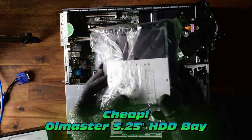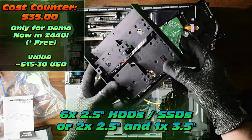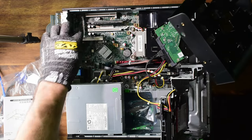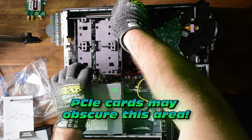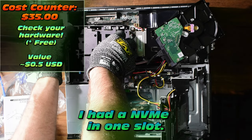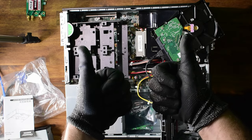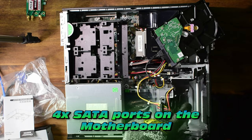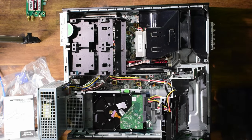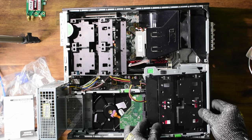Here's our second adapter. I'm curious — there's a massive gap where the PCI slots are. If you're really adventurous, you could drill some holes through the rear I/O, mount it with a couple of screws, and look at that — you could expand this into a monstrous low-power-draw NAS. You could fit at least four SSDs in that one adapter alone, or configure one hard drive and two SSDs, and the second adapter gives you the same again.